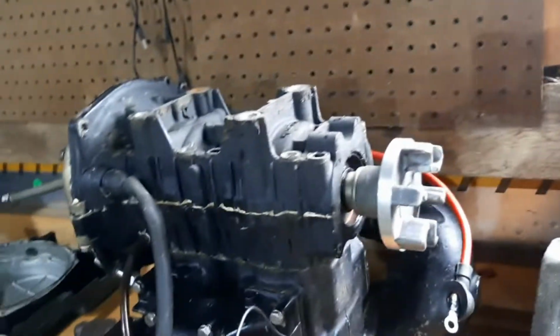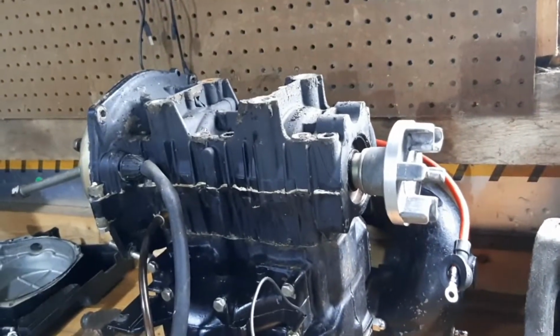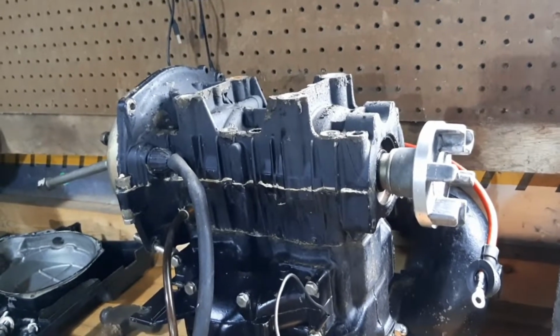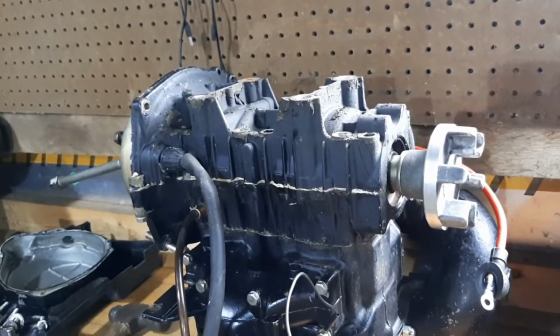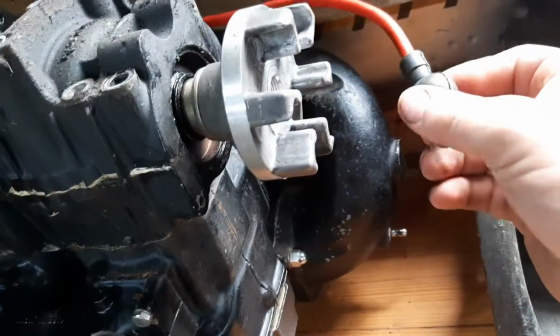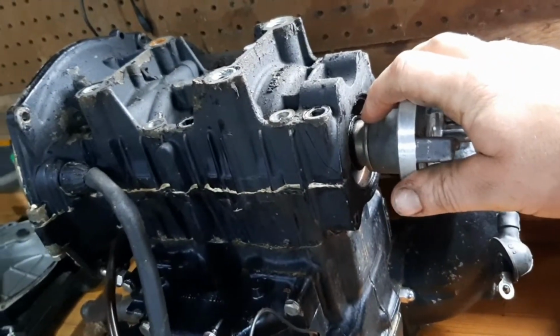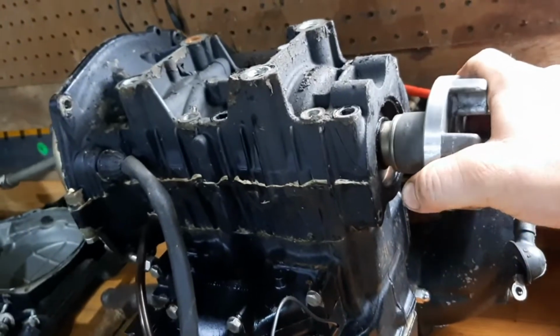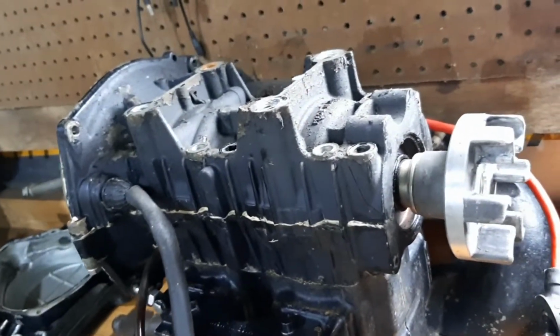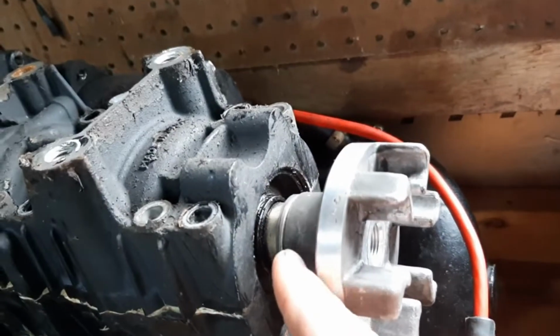So I'm thinking it, and it is beautiful with very low hours. So I'm thinking there's only a few possibilities. The engine itself has got very little wear, but there is one thing that does wear without use, and that would be the rubber bits. So like this rubber cap here, that's fairly supple still. But this seal here is in contact with gas vapors. So I'm thinking maybe the seal dried out and allowed air to kind of flush the oil and gas mixture off of the ball bearing inside. Or maybe even on this end as well. There actually is a little bit of weeping.